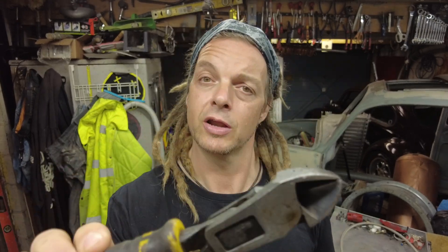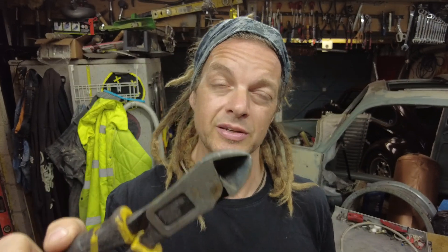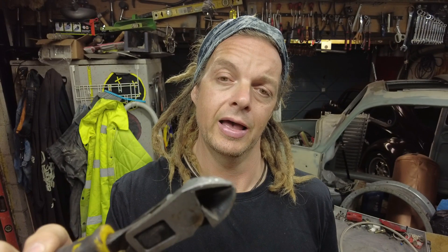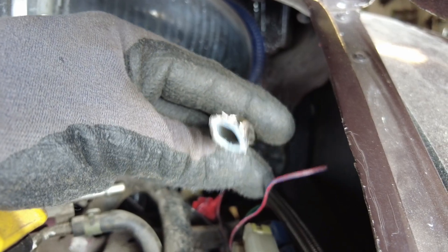My first attempt at cutting the hose, I used these cam cutters. They don't look like much but they bite a lot harder than you squeeze - these bad boys will actually cut through nails. They did cut through the pipe relatively cleanly, however they don't work as a solution because they crush the pipe and didn't cut sharp enough. The pipe was crushed and unusable, so these are not a solution.